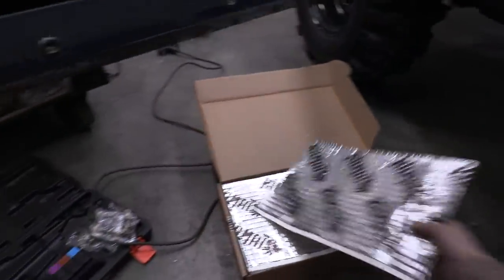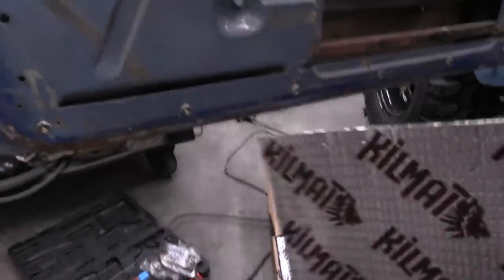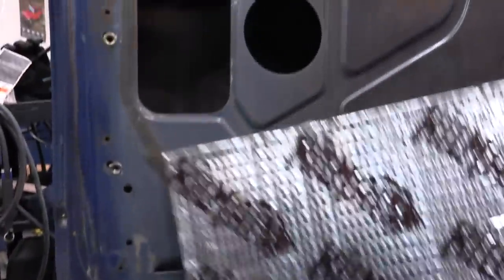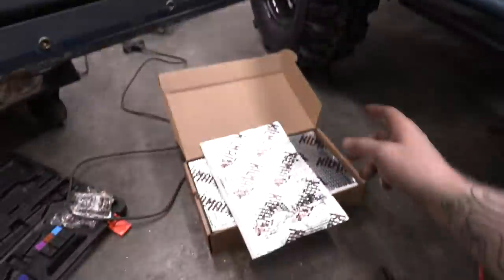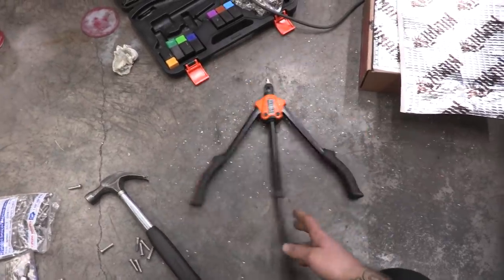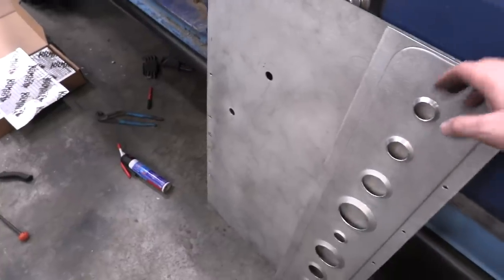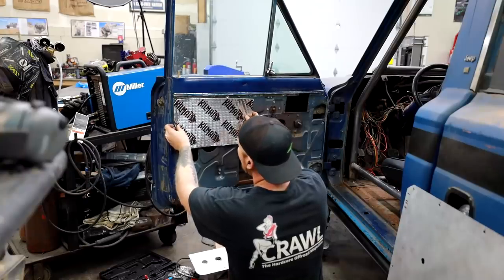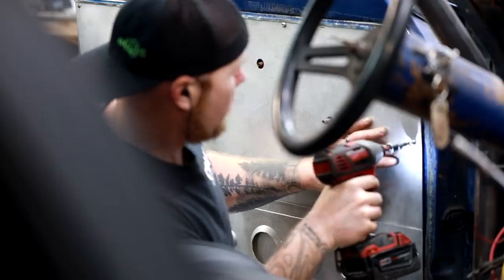The next step is going to be this Dynamat-ish sound deadening stuff. You don't have to go over every hole, but it will help insulate sound a little better if you do, and mostly this is going to help reduce the amount of vibration in the door. I'm going to cut this up and place it around in a way that makes sense. I'll have this stuff and the rivnut tool in an Amazon shopping cart for those who are curious. Extra steps like door insulation and stainless steel button head hardware aren't necessary for every build, but it's really nice to have a finished product that looks professional and doesn't rattle around when you're driving down the road.